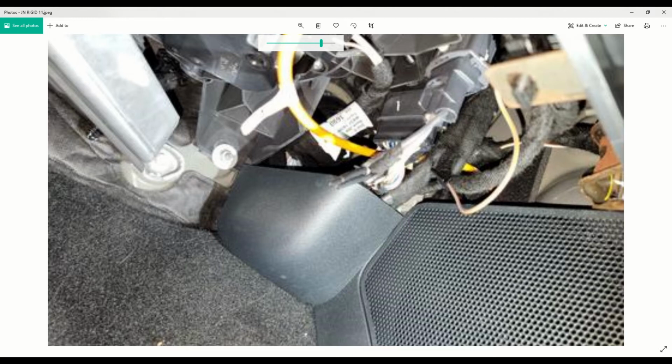Now you can find both here with two choices to jump over to the main fuse box area. Connect the roof harness wire to the white main wire. From here, you can jump to the area behind the BJB. Here you'll see the other end of the two wires in the kick panel, as well as the six color leads. Now, going to the upfitter switches, you can choose the number 2 for a 15 amp fuse, saving the big one for the winch or other heavy draw items. Another connection and boom, done. Upfitter switch 2 now controls the light bar.